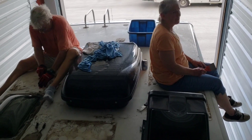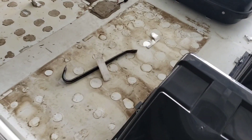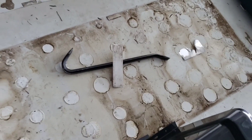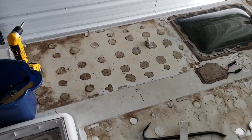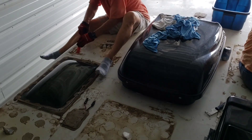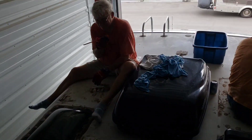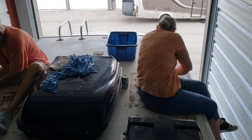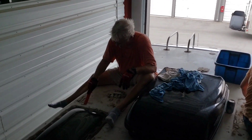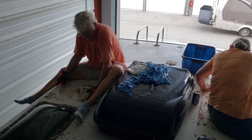We are finally done — we got all the panels off. What worked the best is a crowbar and a thin piece of PVC board or wood board. Basically you just go under the solar panel and break it free from each dollop. Now we just need to take our paint scrapers and clean and scrape off all the dicor. This took us about an hour with three of us, so it could take a single person around three hours.